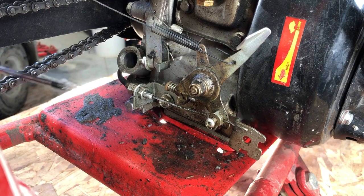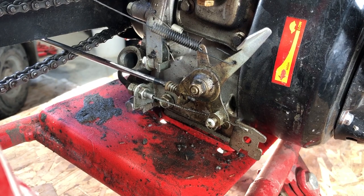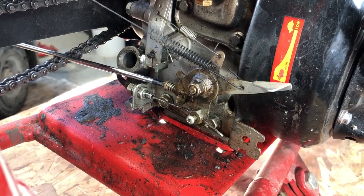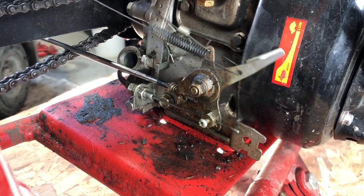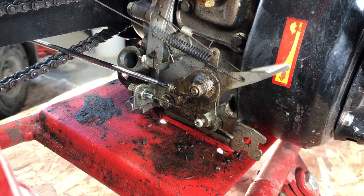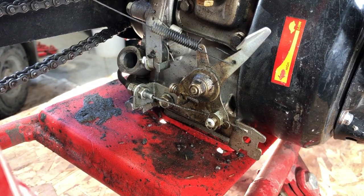So basically, if you bought one of these bikes and want it to go faster right out of the box, make sure the screw is completely unscrewed so it doesn't affect the linkage travel. If you wanted to limit the speed for a kid, you could twist it in so you get less movement — limiting the engine to maybe 2,500 or even 2,000 RPM. Keep in mind that idle on these motors is probably about 1,000 RPM and the clutch probably kicks in around 1,500 — that's just a guess — but you can't go too much lower than that.